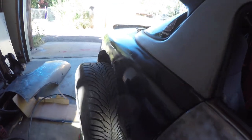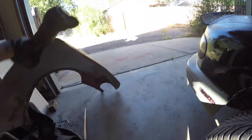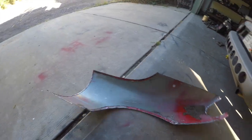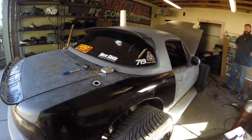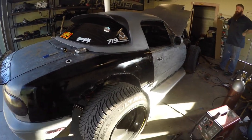I've flat blacked the inside fender so it doesn't rust. I've trimmed all of this and rounded all the edges so that it's just a skin basically. Now I'm ready to tack it on and then massage it and bend it and angle it to where I want it so the tires don't hit.